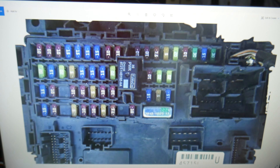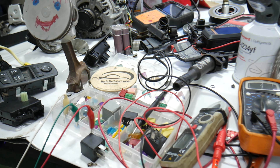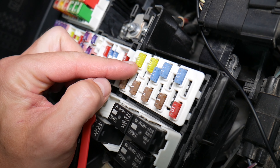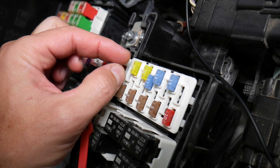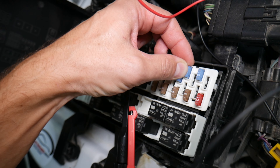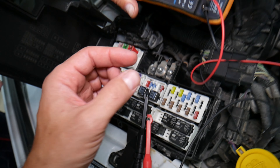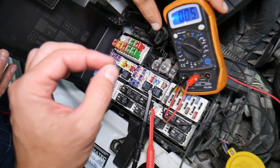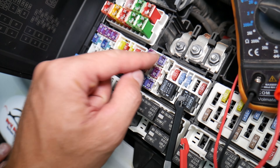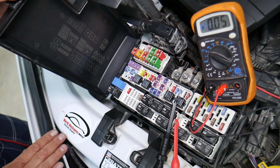Before we continue, let's explain quickly why it's always a good idea to test fuses and relays. Fuses — not often can you see if they're burnt or they're good. Sometimes they may seem perfectly fine. You think it's a good fuse, you put it back in, and you end up spending money and time on parts and problems that don't exist, when all you had to do was test your fuse, find out it's bad, and replace it to fix your problem. We'll have a video on how to test fuses and different kinds of fuses, and how to test relays — we'll put the link in the description below.